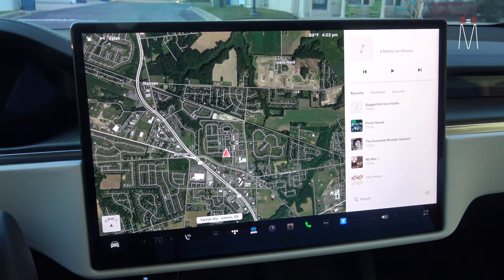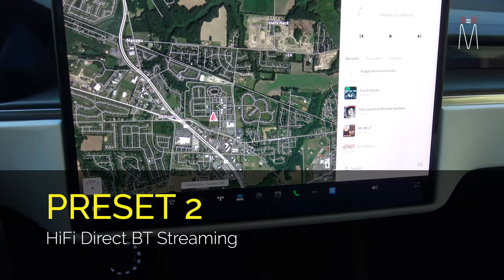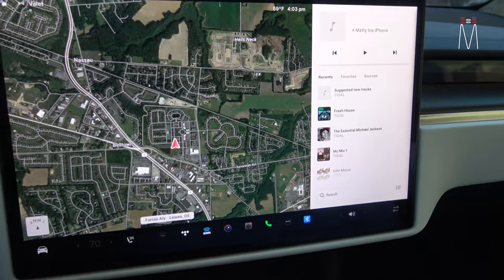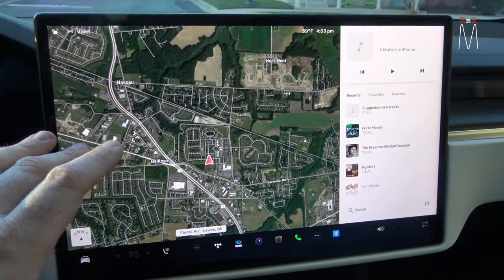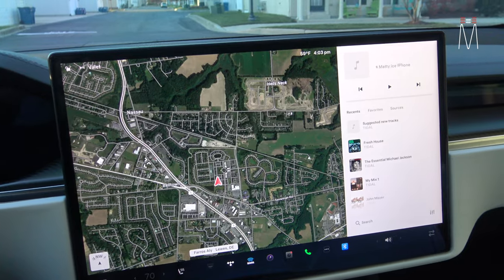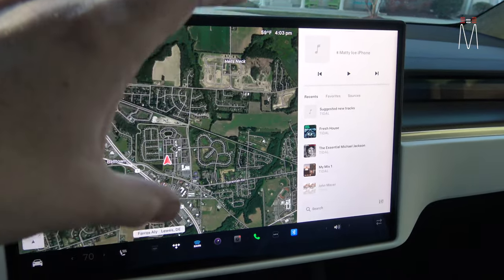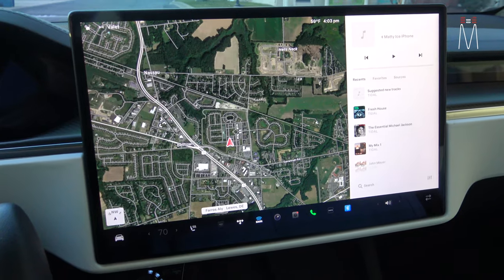That's why I always offer additional presets. Preset two is a higher resolution Bluetooth streaming connection between my phone and the DSP. You see it's connected to my phone — I can play anything from my phone, and my phone is still going to transmit data to the MCU. So I'm connected to the DSP and the MCU at the same time — I just select where I'm casting the audio from my phone. I say 'I want it to go to the Tesla HDBT for the audio,' and I still see all the information on the display, including album art from the MCU, while audio goes directly to the DSP.